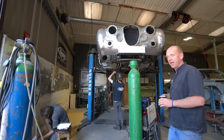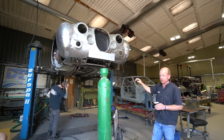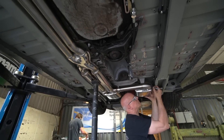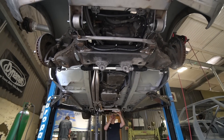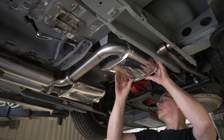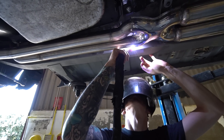Moving on, we're on the Churchill Jaguar and Tom is doing some welding on the exhaust system. The principal progress this week has been the exhaust. Stu's been working on getting all the fit-up done on the final parts and is pretty much getting there now, working on the two over-axle sections and working out the curves. The radius on the 90-degree bends is too sharp; we decided it's better to split the bend and lengthen it, giving more adjustment above the driveshaft area. Tom's now getting final welds done on all the sections Stu has tacked up.